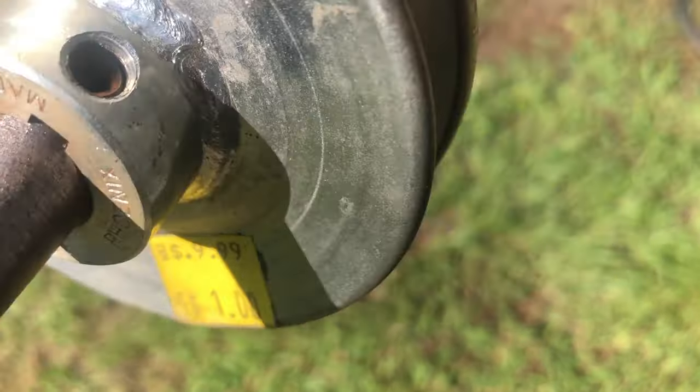So on this bracket, I got to heat it up here, bend a 90 degree, and then we'll cut it off whatever length it needs to be. Weld this. The hole's already drilled. We'll have one hole to drill. That straight bracket now has a 90 degree angle. That's what bolts to the tractor, and I got to figure out how long we're going to cut it off.